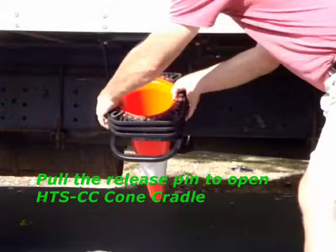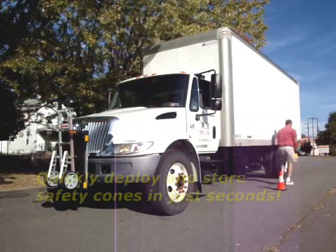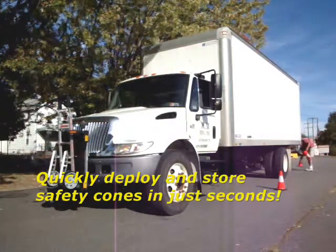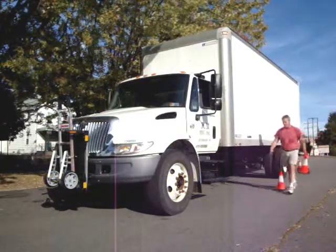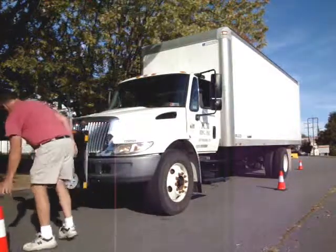What is the three-cone safety policy? Positioning one safety cone four to six feet at the rear of the vehicle to create a safer work cushion when using ramps or lift gates. A second safety cone deployed midway on the driver's side slows traffic and warns motorists that a worker may suddenly appear. A third safety cone is placed four to six feet in front of the vehicle to prevent getting boxed in.